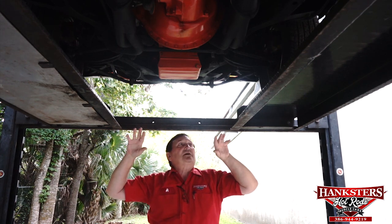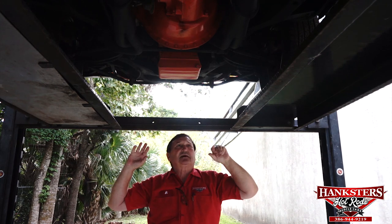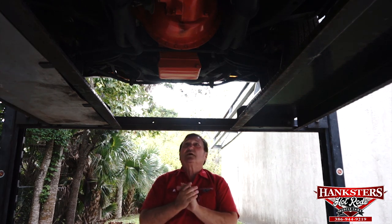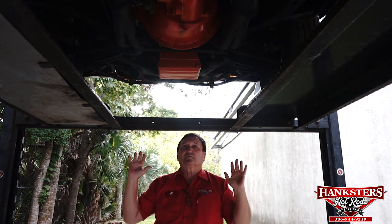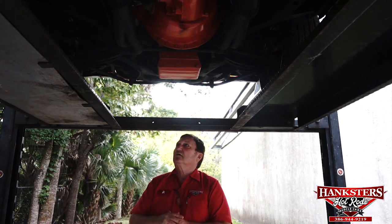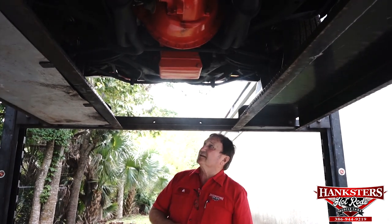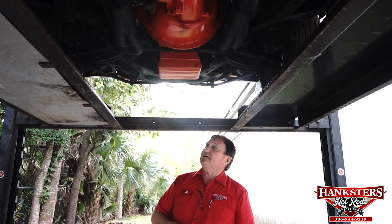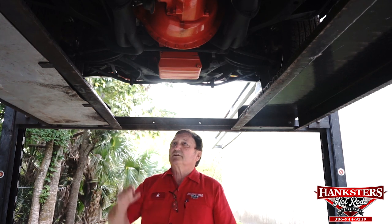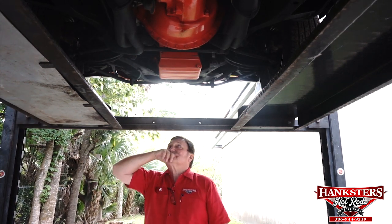There's not very many miles on this car. If I remember correctly, it's somewhere around 30-some thousand. And I believe it to be actual miles on the car. Judging from the interior and all the undercarriage appointments and everything, I'm going to call it a real mile car. The headers themselves are at least 2 inch, possibly 2 1/8, 3 1/2 collectors going into 2 1/2 primary tubes back to the turbo mufflers.